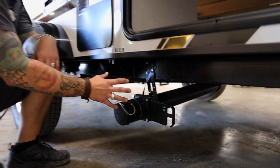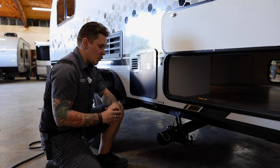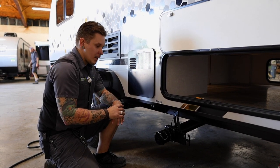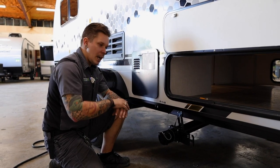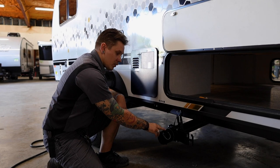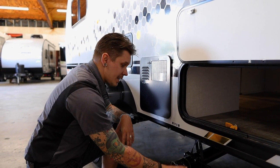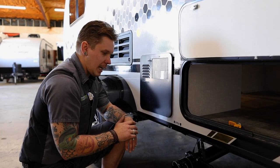It's even more important that we do so with this black water tank because we have not only solid body waste, but we have toilet paper, all of that stuff within the tank that is constantly compounding, and we want to keep that in as wet or flowing condition as we can. So again, we're going to use the monitor panel on the inside. We're going to watch that tank fill up. When it becomes full or we are wanting to dump, we are then going to hook up our sewage hose here, and we're going to pull that valve, in this case, about 6 inches towards the rear of the vehicle. Again, I can't stress that enough. Very important that we do keep that in as wet or flowing condition as we can.